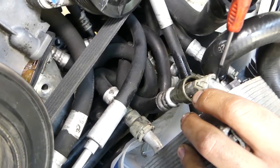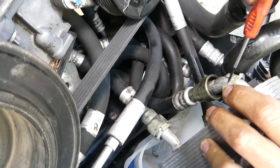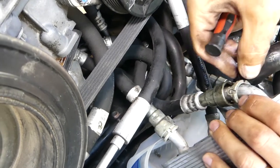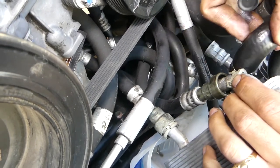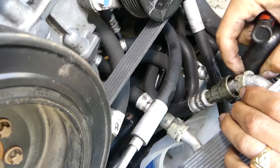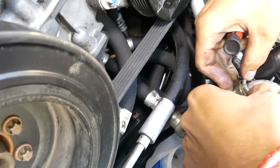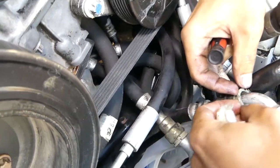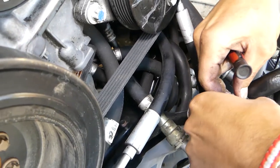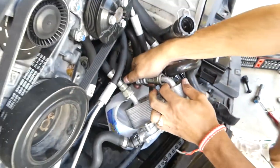That's why it's not recommended to use a screwdriver to pry those things out. You have to use the BMW quick disconnect tool. If it's missing, you can buy one, cut it in half just to use it one time, put it over the pipe like that, then push it in place. It goes between the teeth, and after that you can go ahead and use it. Thank you guys for watching, please subscribe, and see you next time.